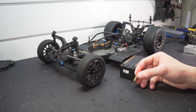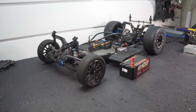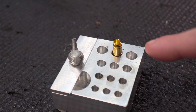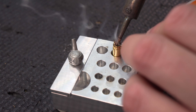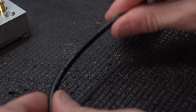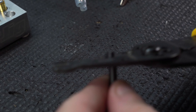I didn't really take something into account when purchasing this pack though. A while back I did a video switching my ESC over to bullet connectors, and this is five millimeter bullets which is on most of my shorty lipo packs. But this one has eight millimeter bullets. These are the bullets it came with. You can actually see the difference here — the eight versus the five millimeter. It's a huge difference. And because I still have one other battery that's perfectly fine and runs a five millimeter bullet, I'm not ready to switch over to the eight millimeter just yet.